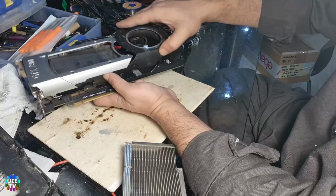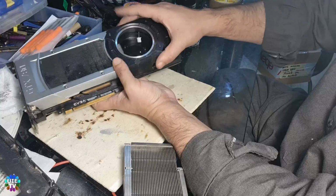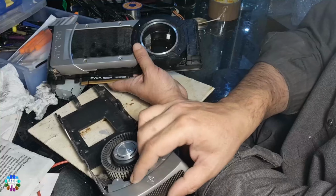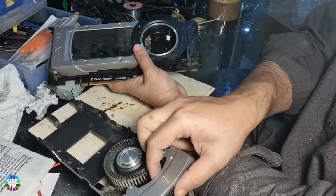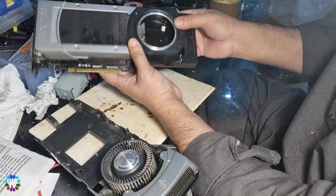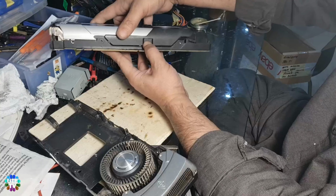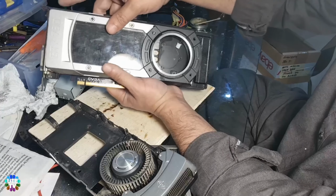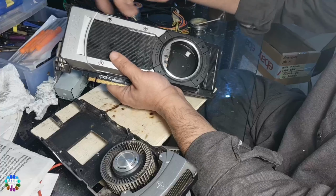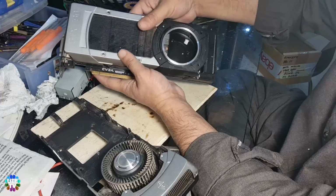Yeah, sitting there. And finally, from the 780 Ti, the last piece is this plastic. Remove this plastic with a couple of screws on this one, and then take this plastic up here, and it's ready to go. That's how simple it is. It's going to fit in the same place as the 780. Obviously it will show you GTX 780 on the body, but you can ignore it because you're going to use it inside the computer anyway. It's not sitting on the table most likely.